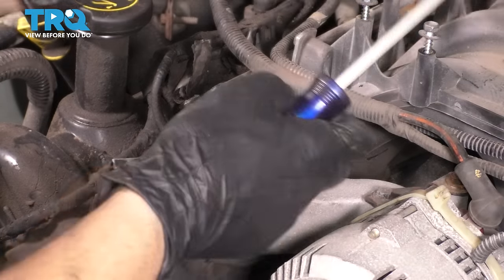A little bit left. See, now right around the piston rings there, it's important to get it all off because that's where the head gasket will most likely not seal if there is buildup. And then you definitely don't want to have to do this over again. I'm using a new razor blade, by the way. I used a new one the first time. I'm using another new one now. I don't want a damaged blade scraping up the surface.